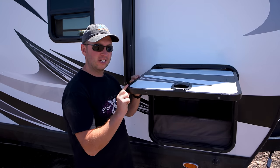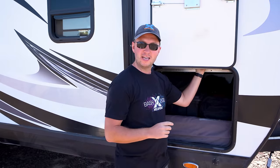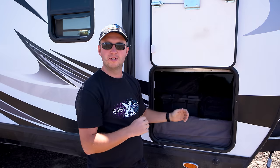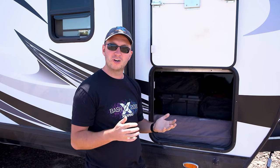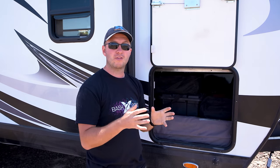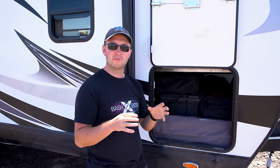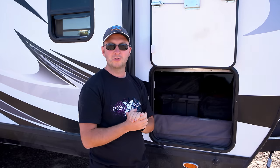Overall the insulation in our trailer is really good, but we found an opportunity to improve it further by adding insulation in the panel between the storage bay and the inside, and also in the section that is the underside of the nightstands in the bedroom. In really cold weather those nightstands were just cold to the touch overnight. Since adding this insulation it's really improved — a super quick, super cheap mod that Outdoors RV liked so much they integrated it into their trailers. We actually saw the very first trailer with that mod built in roll off the assembly line during a factory tour.